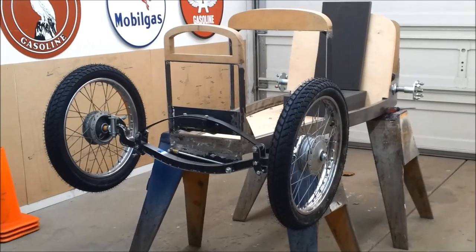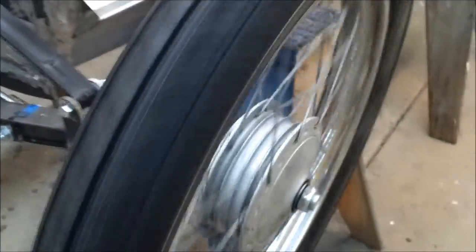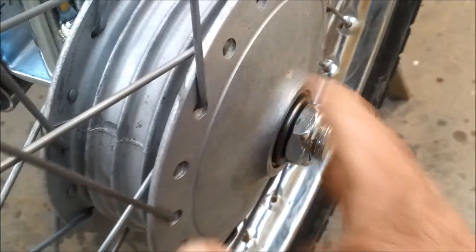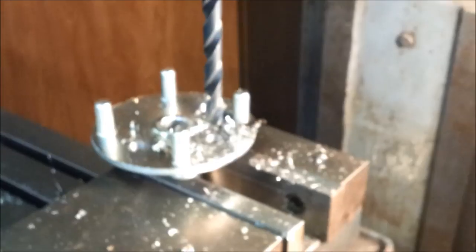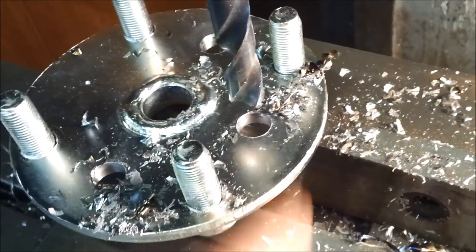I messed around with these front rims for a couple of hours. I got the tires and tubes on and installed them on the spindles — everything's looking pretty good so far. They spin real nice. I've got them fairly snug with the spacers that came with it in there just temporary. On the other carts, I've cut this spindle off once I had the wheel where I wanted it — used a sawzall and it wasn't too tough. I'm using a half-inch drill bit here to drill through this hub for the bolts, which are half by three. This hole is one and three-sixteenths centered between the two studs, and fifteen-sixteenths in from the edge — which puts the hole where you want it in the hub.